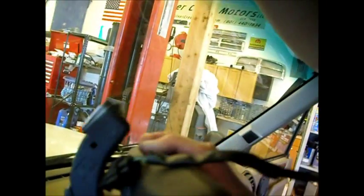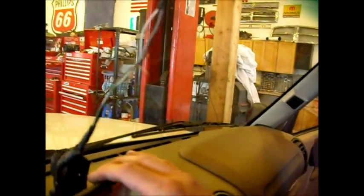The compass is kind of a gimmick — the bottom lights would have been a little nicer — but it's fun and cost thirty dollars at the local junkyard. There's no retaining screw; it just clips in, and on the back side there's a retention clip that keeps it held on. Sorry, the wires are exposed and I don't want them to touch the retention clip. Then you just put your plastic trim around it, reinstall everything, and you're good.